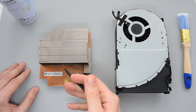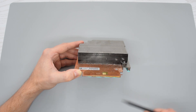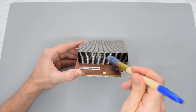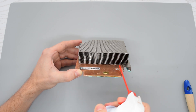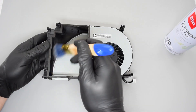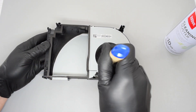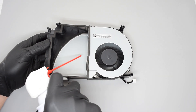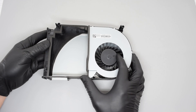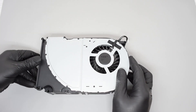Let's start by inspecting the cooling system. This is the side of the heatsink where all dust and dirt begins to build up. You can use a paintbrush to brush off the dust, and then use a can of compressed air or a blower to blow any remaining debris out of the heatsink. Now repeat this process for the fan assembly — just give it a good blowout to make sure it's nice and clean. Also try to spin the fan by hand; it should spin easily and freely. If it doesn't, I'd recommend replacing the fan — the link is down below.